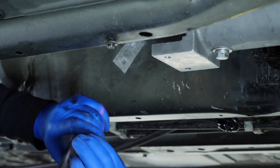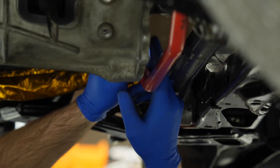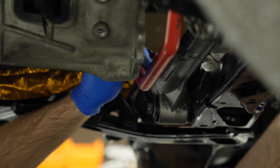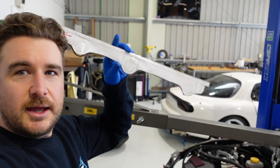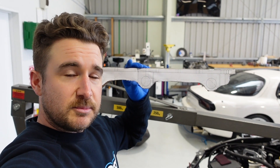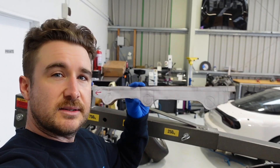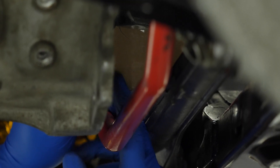There are a couple of different dimensions we want to get it square over. One of the first things we're trying to clear is where the sump is going to be relative to the crossmember. We're converting this engine from wet sump to dry sump, but that new dry sump isn't here yet — we're waiting on freight. So we've got a cardboard template which is the side profile of the new dry sump system, and we're using it to make sure the engine and sump will clear the subframe.